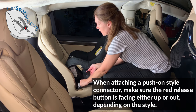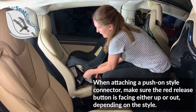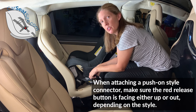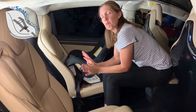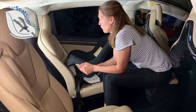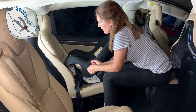I also want to take out all of this slack. So I'm going to pull on the strap, and as you'll notice, as I get tighter and tighter, it just stops pulling. So you'll notice though that there's quite a bit of movement here in the seat, and we want to get less than one inch of movement. In fact, I always aim for no movement at all when I'm installing my seats. So there's a problem here and there's still some movement.